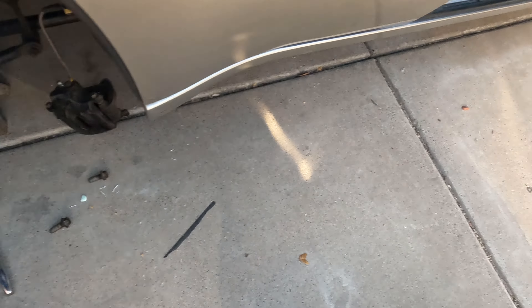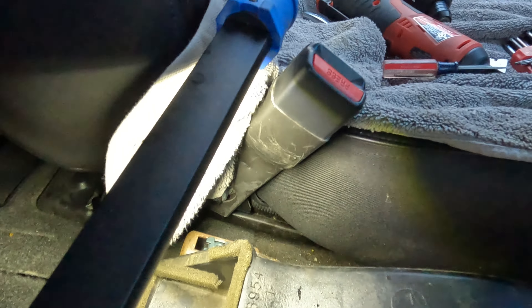Welcome back. I figured I'd show you what I meant about having a ratchet back here. This is the e-brake cable bracket — that's the cable — and I basically just wedged this, which is what I had readily available, between that to give me more slack. That means the e-brake pads are pulled out. I had to do this side too, so I took this all apart. On this side I used a nut — hey, it's not stupid if it works. With doing what I did back there, I did not have to unwind the front any more than I already showed you. Granted, if I could have gotten all the way down to the second or first tooth it would have helped.